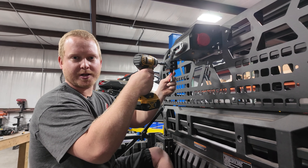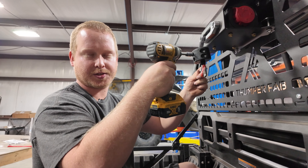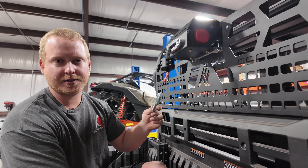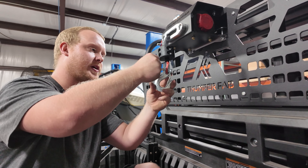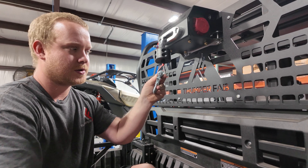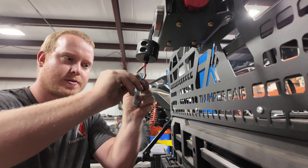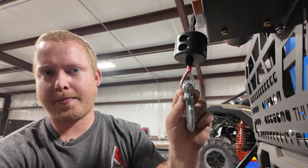When you're fastening your winch stop to the winch cable, you want to be sure not to over-tighten it — just snug the bolts up and that's all you'll need. Once you have your winch stop tightened up, you can move on to mounting your winch hook. You'll simply slide the clevis pin through the winch hook through the cable, then use your cotter pin to lock the clevis pin in place, spreading the cotter pin out so that it can't back out.